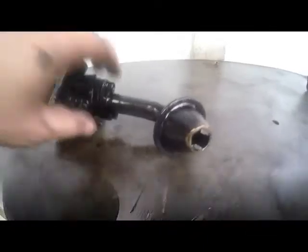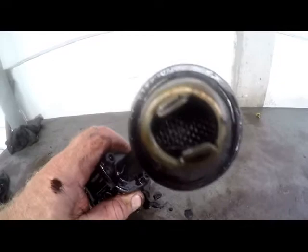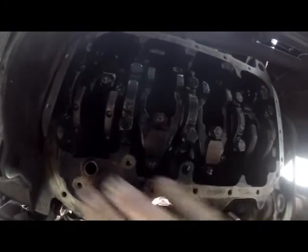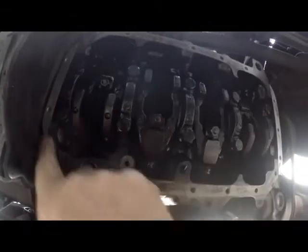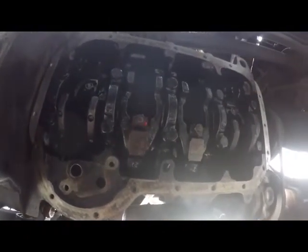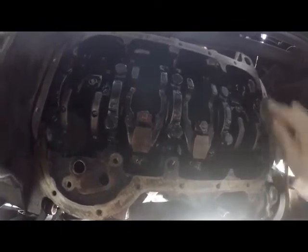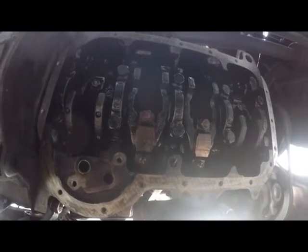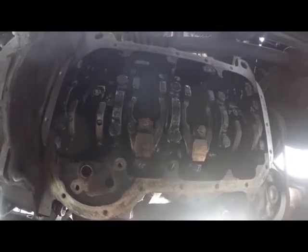So now my suspicions are onto the pump itself. You can see the sieve inside is absolutely clear, no blockage — but the pump could be having a problem with it. Once we've taken everything off — the pump, the sump — we just have to clean up all the contact surfaces. Make sure the old gaskets are taken off and that it's nice and clean. I've used a gasket scraper to take off all the oil gasket and sealer. We need a nice clean surface on the sump side as well — you can put it on a grinder with a brush to clean up all the bad spots.